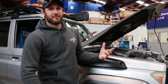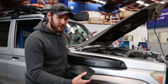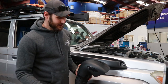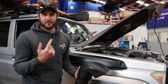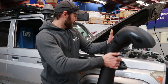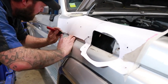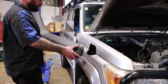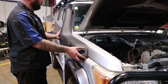It's got the cyclonic head on it, which is great for dust, but it doesn't give you that air ram effect like the Safari one does, so you're getting nice clean air. A lot of people turn these around in the rain - there's no reason to do it. It's actually designed for the rain to come in and get spurted out the sides. Anyone turning their snorkel around is not getting the air ram effect, so leave it facing forward. We've got to cut the guard a little bit bigger to fit the larger intake and the same with the air box, but Safari supplies a kit to seal that all up nice and tidy and make sure it's watertight.